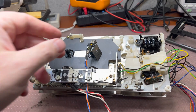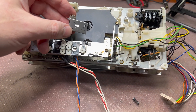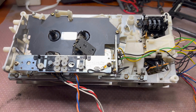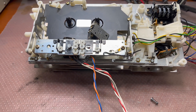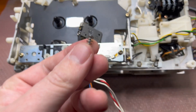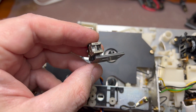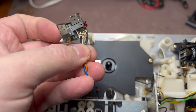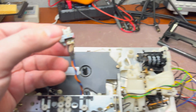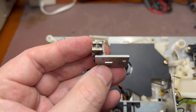Finally I disassembled the 482Z. This took twice more time because there was incompetent assembly which tied all wires across multiple metal pieces - it was not assembled in the correct order. So here I just pulled up the pin - you may see the pin, it just sits here and holds the head. Here is the head assembly. I will just disconnect these wires and work with the other tape transport which I have already disassembled here, to swap the heads and put them back. When I disconnect both of them, I will do a part on the microscope so we will be able to see the differences.